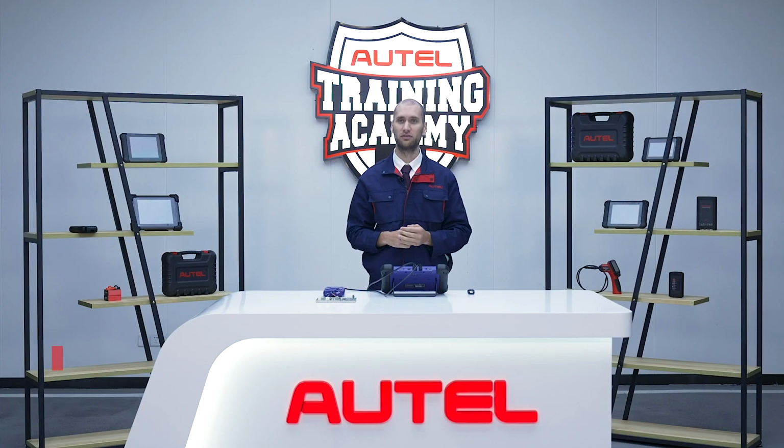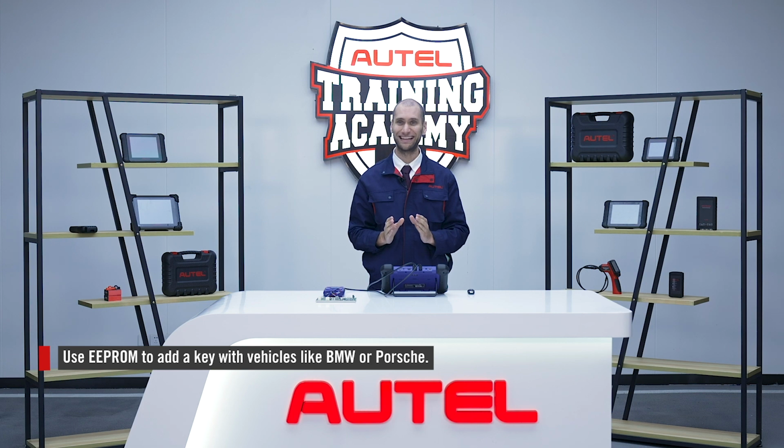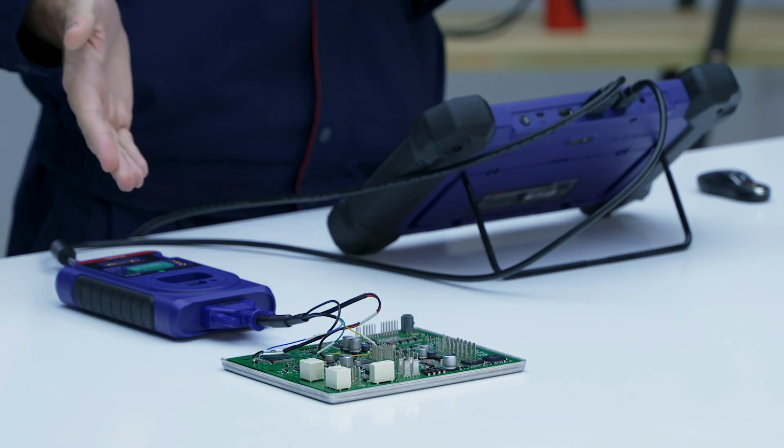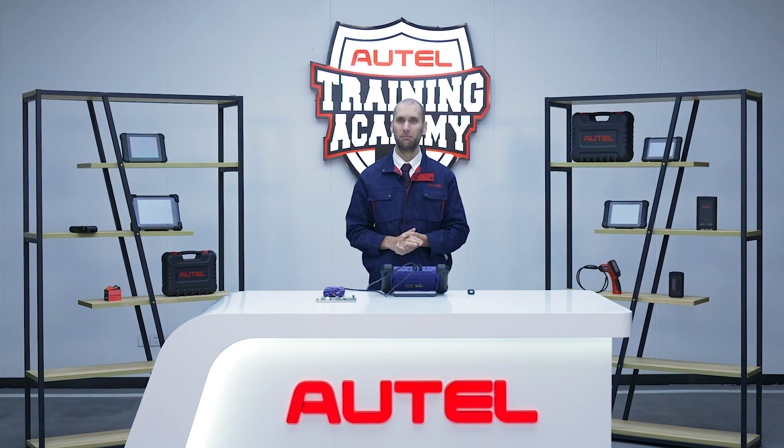In this video, I'm going to show you how to program a Porsche key in an easy way using D-Flash, meaning we will read the data from a chip. So first, let's take out our chipset from the immobilizer system. We need to read information from this chipset by connecting it with our XP400 Pro key programmer. Make sure you're connected to the key programmer and the programmer is connected to the tablet.